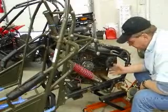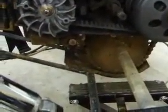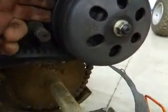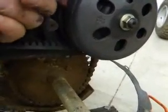Slide this out of the way and here's your transmission. Here's your variator fan right here, and your variator is actually behind the fan. This is your clutch bell, and then your clutch slide face pulley. The clutch is inside here — you can see it in between these holes.